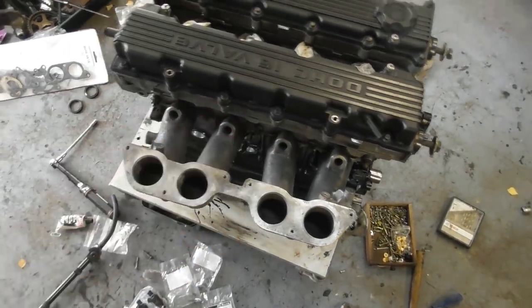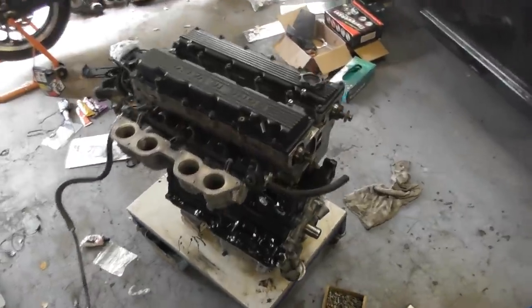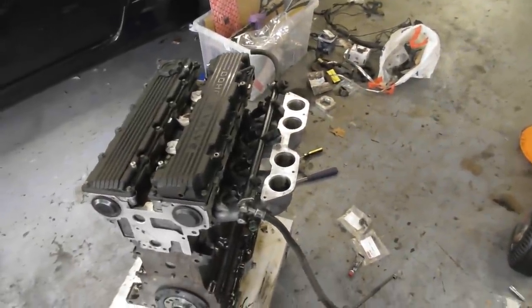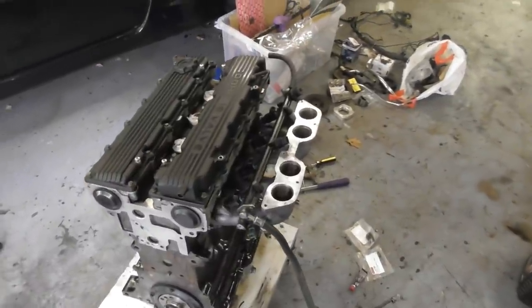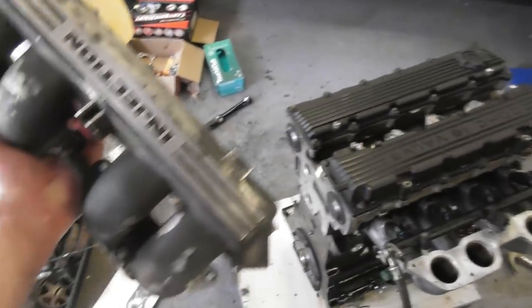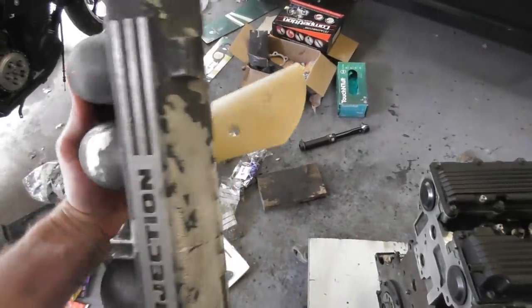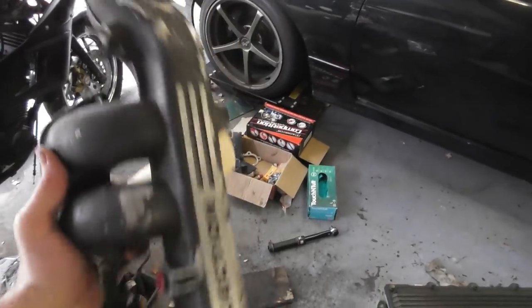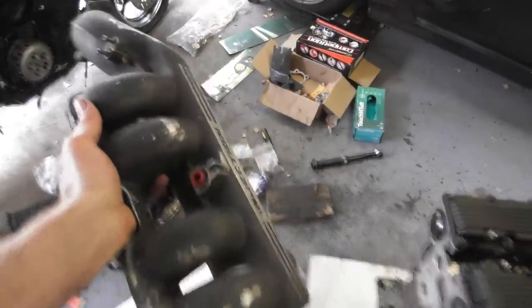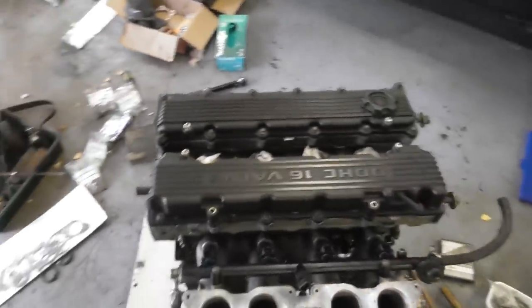When that's in, I can put the top part on with its new gasket. I'm not doing action shots because it's all fairly boring putting stuff back together. I forgot the top part of the plenum is rather ropey looking, so I've been sanding that down. I'm going to give it some etch primer and then some satin black. While that's drying I'll go have a cup of tea. I might put my little heat gun inside to warm it up a bit, which will help the paint go off faster.